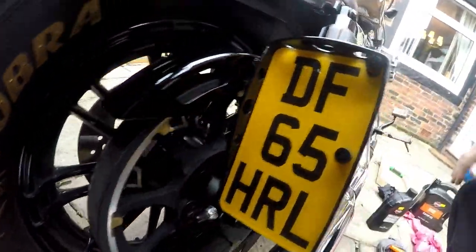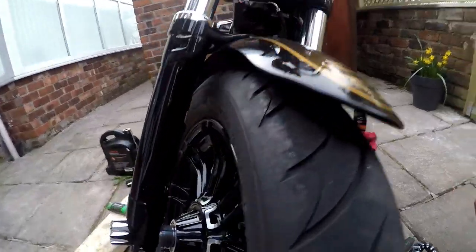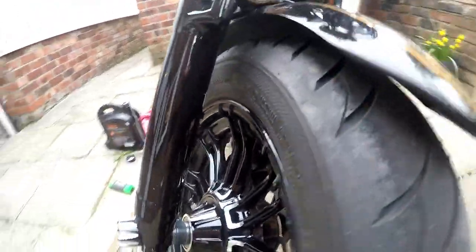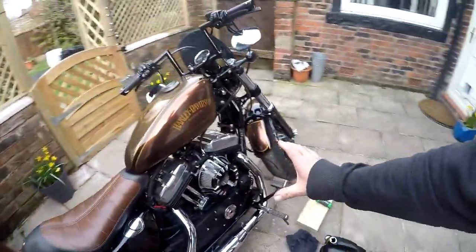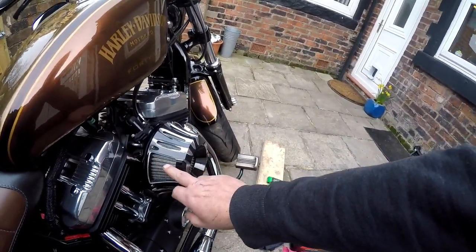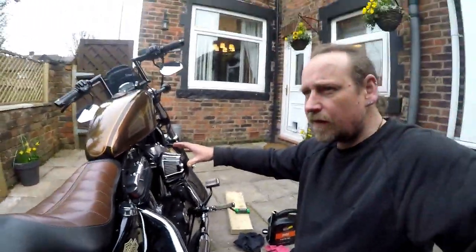Check your pulley. And one of the most important things is the brake pads — mine are about 50% there, so we're still okay. We'll probably change them in a couple of thousand miles. And if you run a standard air filter in a box, remember to take the cover off and check the filter unit. If you're running something like a K&N type or a mesh type — like the Arlen Ness one — these have a special coating so they're not oiled. Most of these filters have a red tinge, and that's the special oil for those type of filters. Over time you'll find that oil wears and it becomes like a pink colour, meaning it's not doing its job 100%. So it's a good idea to look at how to re-oil your filter if you've got one of those types.